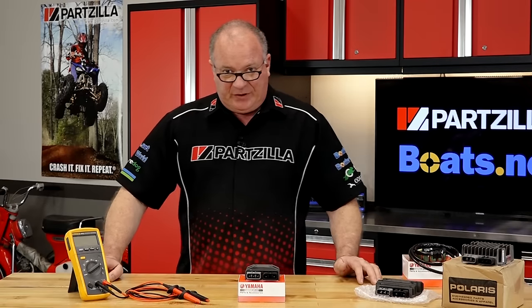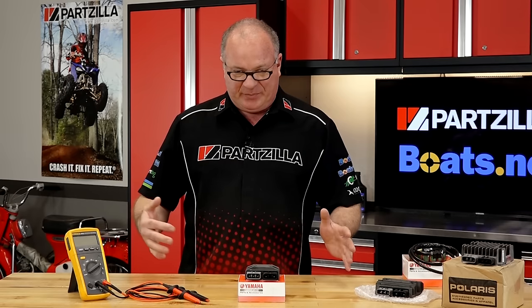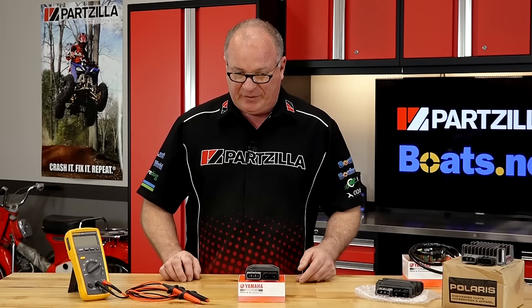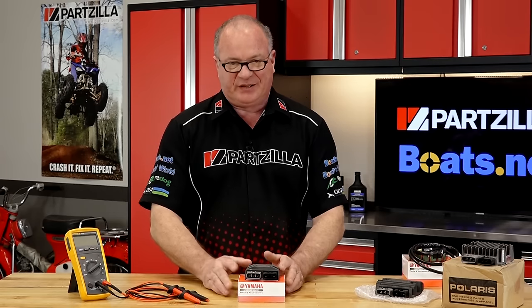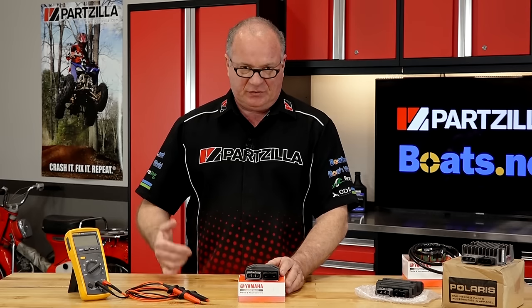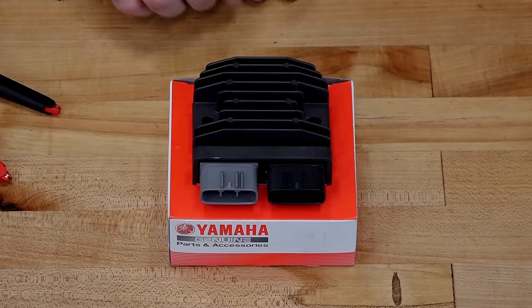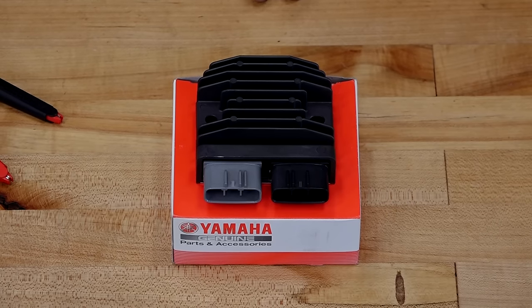So if you're watching this video, chances are your machine is not charging. Now, if you've already eliminated the possibility of a bad battery and your stator is getting a good output, we have a video on that, by the way, chances are it could be your regulator rectifier. What this thing does is take that AC signal that your stator is developing and convert it into a DC signal that is used to charge your battery and provide power for whatever load you may be using on your machine. Usually between 12.8 all the way up to 14.1, depending on what type of battery is in the machine.